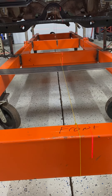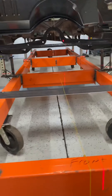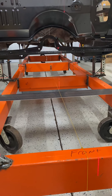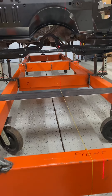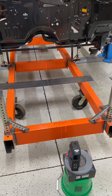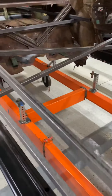If I go down through the body right now, every one of these would be true within the width of the line. And then I can also set it up to where I'm shooting straight down the body, and I can use my tape measure to take some dimensions — cross car, fore-aft, et cetera.